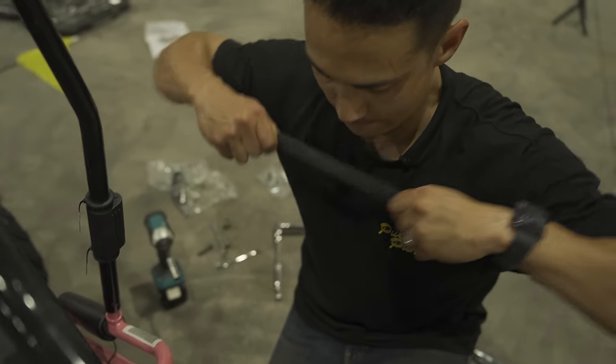If you need to adjust your chain, the gold U-plate is your chain tensioner — it consists of adjustments by two nuts. Underneath is your main nut; use an 18mm wrench to loosen it. After you have some play, go over the bar and use the same 18mm wrench for the top nut — this is where you can take slack out of or add slack to your chain. Give it a few turns, play with the chain, see how much room there is, adjust from there, then tighten up that bottom nut and you're done.